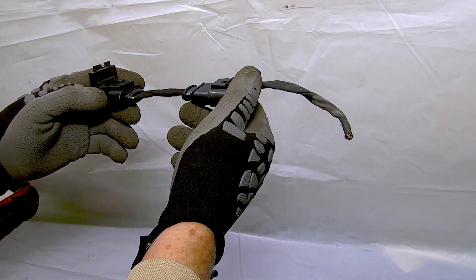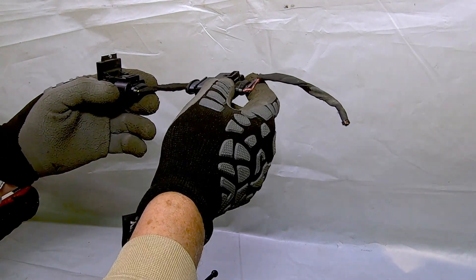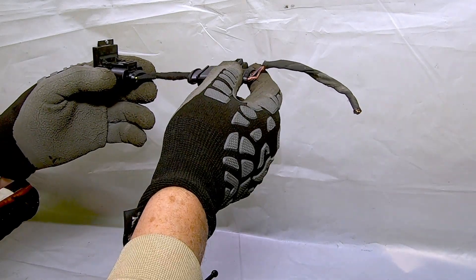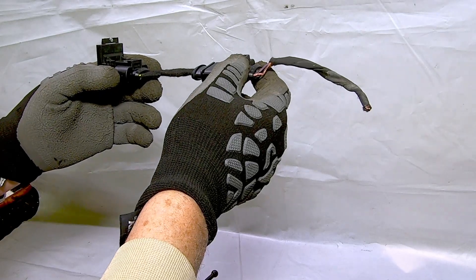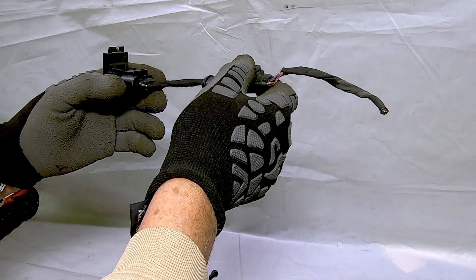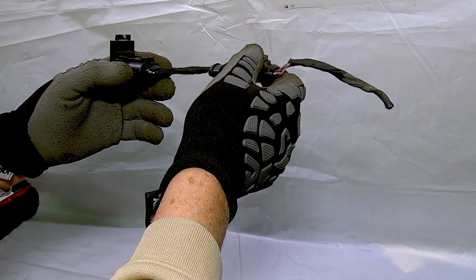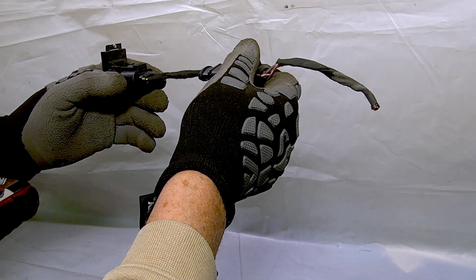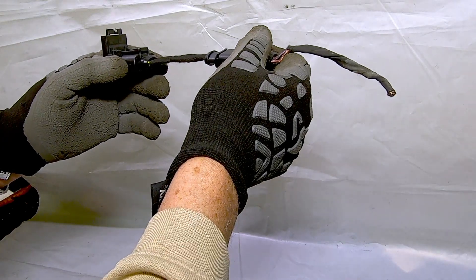The reason I built it as a removable harness is this: if you leave the bypass harness in and somebody buys your car, it no longer has the clutch start feature. If they go to start it in gear and run into a wall or another car, they're going to blame you and come after you because you disabled a safety feature on their car.